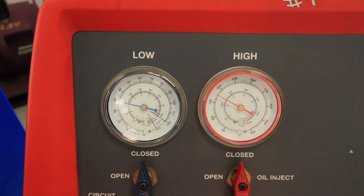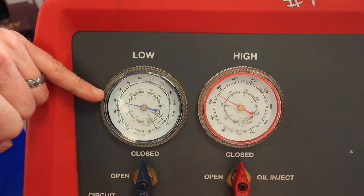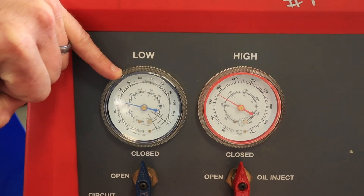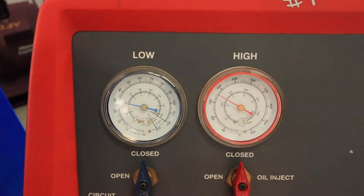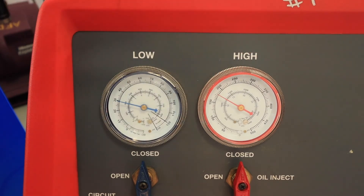With everything hooked up I can look at my pressures. This truck's air conditioning is functioning well and these are good solid pressures for normal operation at idle. My ambient temperature right now is only about 75 degrees and the truck sat in this room overnight, so 30 psi on the low side is a great reading — that's really what we want to achieve with R134A. If that number crept up much higher at idle that could be a sign the compressor is having trouble or there's an issue with the orifice tube or expansion valve. On the high side I want to see somewhere between 150 and 200 psi typically at idle — a steady reading without much fluctuation. Higher pressures on the high side are typically a sign of an issue with the condenser not cooling the refrigerant properly, which can be caused by a condenser blockage or a fan issue.